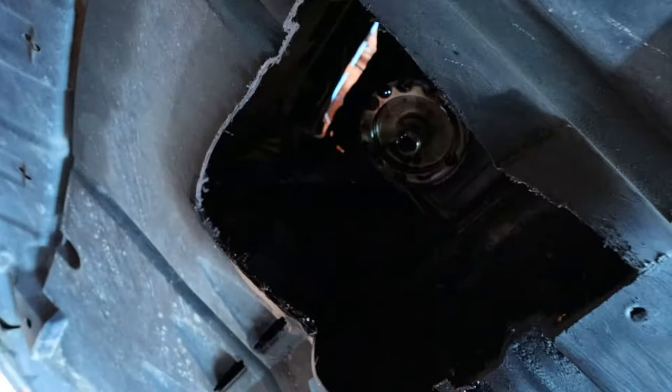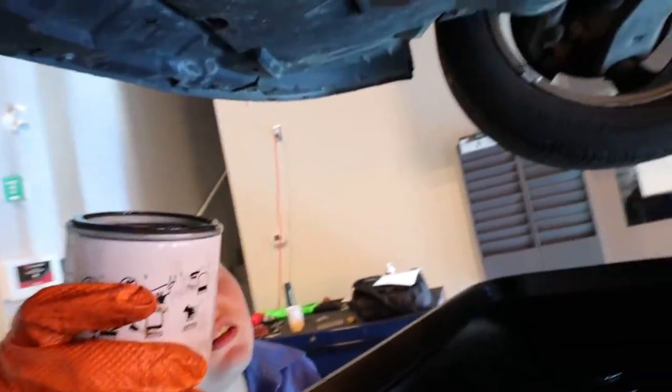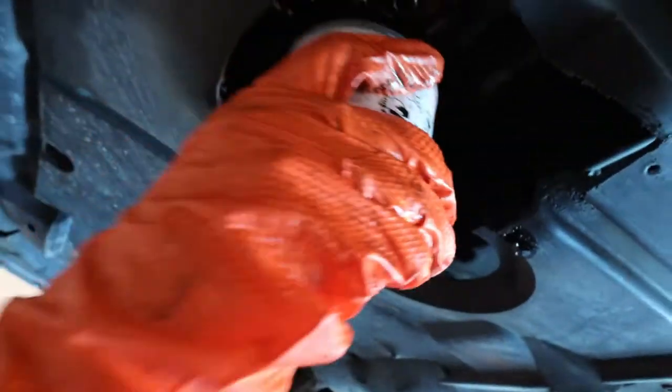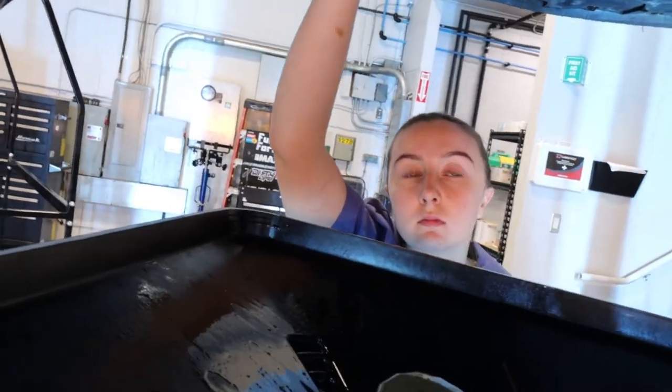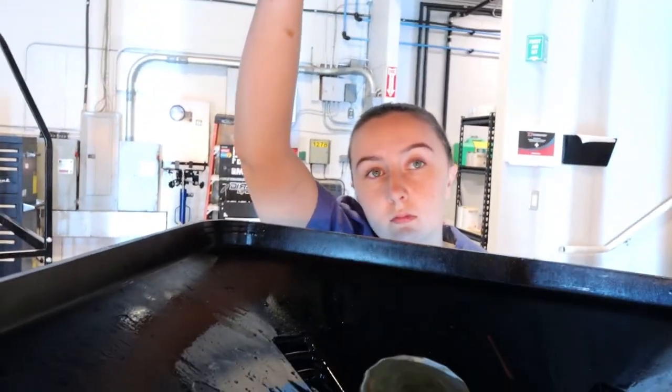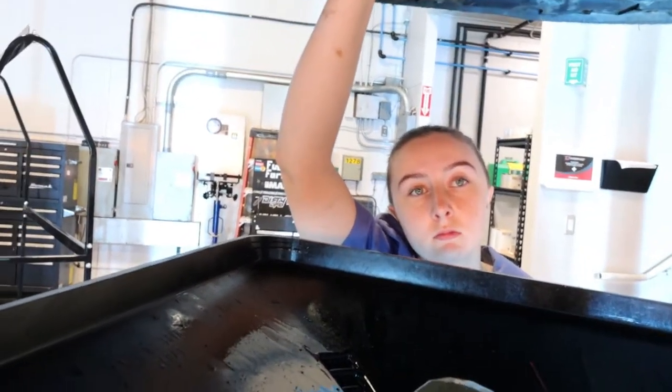You put it back on there. Before you put it on there, you want to make sure there's no gasket from the last one. So you know the gasket you just lubed up? You want to make sure the old gasket's not there. It's not there. So just twist it on. You twist it until it touches, until you feel it touch. Okay, so twist it until you feel it touch. It's touching. Okay, so now you go 3/4 of a turn.